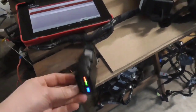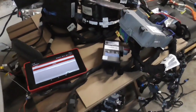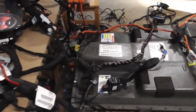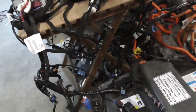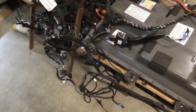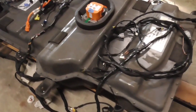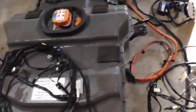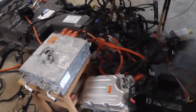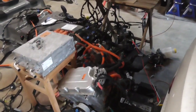I also tried plugging in the telematics module but none of this is making any difference. I think being a CAN bus-based system, the CPU is basically controlling the whole car — not just the motor but everything. With half the stuff not connected to anything, even if it's not related to the powertrain, the computer just thinks the car isn't there. So plan A — using the original wiring harness — was a great fantasy, but it's turning out to be just that.